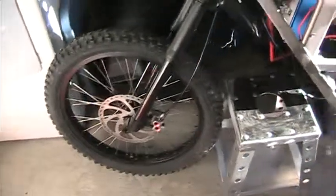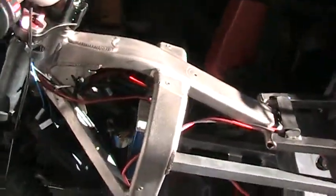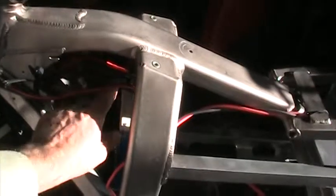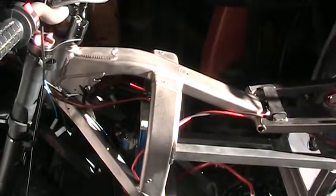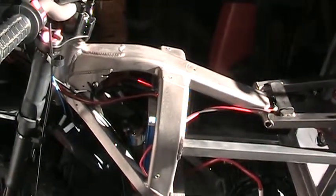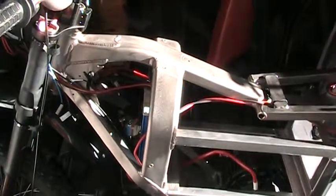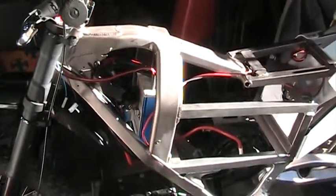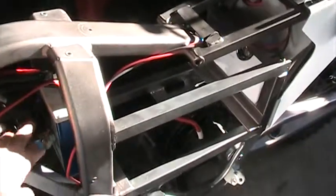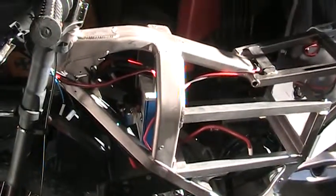Switching everything out is absolutely no fun and it's going to cost a lot of money, so get a good donor bike. Start out with really heavy gauge wires. I tend to overdo it with both the gauge and having a little extra length in case something breaks. When wires get heated up they oxidize, and the oxides on the copper make it a real problem — you have to chop cable length down. Unlike a factory production build looking at cost per unit, on a one-off build you can use a little extra wire. The contactor here feeds the huge amount of power into the Altrex controller when you turn the switch on, so you really have to have that large relay — and again they're around $50.